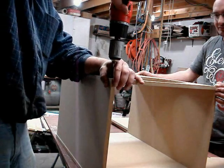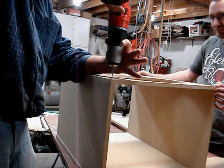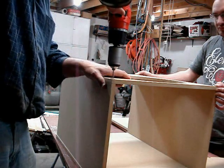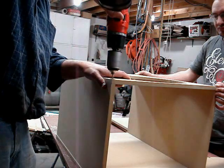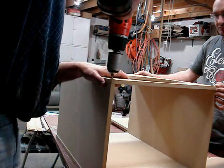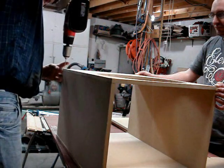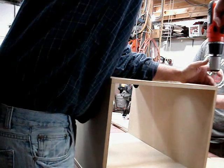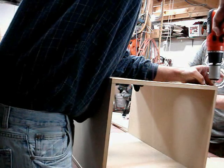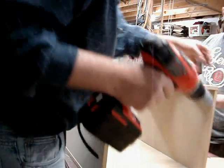Now we are doing the preliminary assembly. We have not applied any adhesive at this point. Using a set square to level up the corners and the edges, we have placed the baffle on top of the two side walls. We will be drilling these initial pilot holes in each corner. The pilot holes are essential, as when we put the screws in, there is potential to crack the wood. Do all four corners first. Once we have completed drilling the 4 guide holes in each corner, we can move on to applying the adhesive.